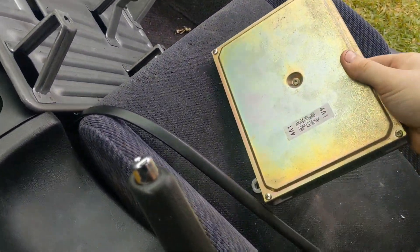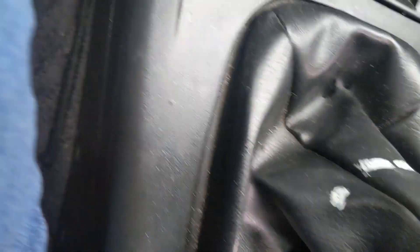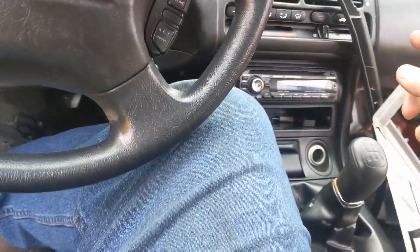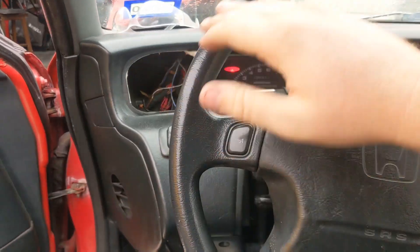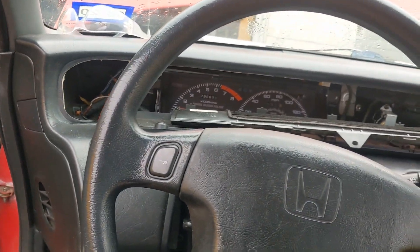I'm here in the interior — it's torn apart. Here is the ECU that was in it. You can see here that it says P14A10. That is a H23A1 non-VTEC ECU. We have swapped in the P13N01, which is a JDM H22 for my 4th gen JDM car. Car runs right, idles beautifully, revs great. You got the nice little exhaust burbles.